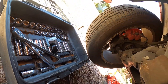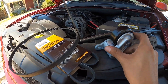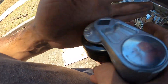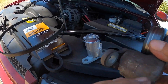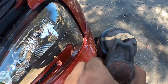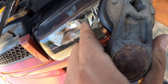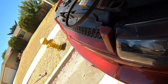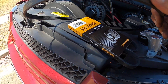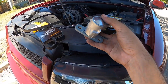Here's a quick look at the old stuff and the new stuff. This is the new one right here - it spins fairly freely. This one right here, the old one, is extremely hard to move and it's making all that noise. More than likely that was causing the issue. Here's the old belt - it's kind of chewed up a little bit. We got a new one, let's go ahead and install this, and we're going to do everything in exact reverse order.